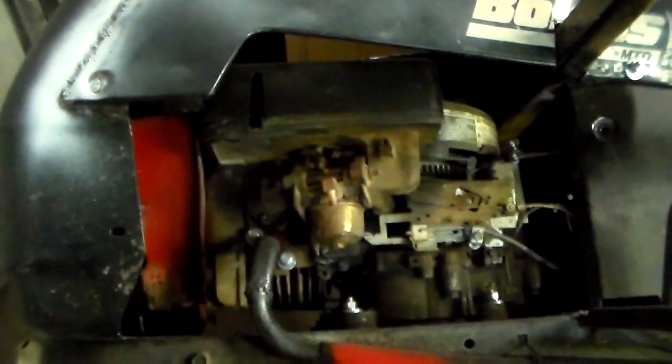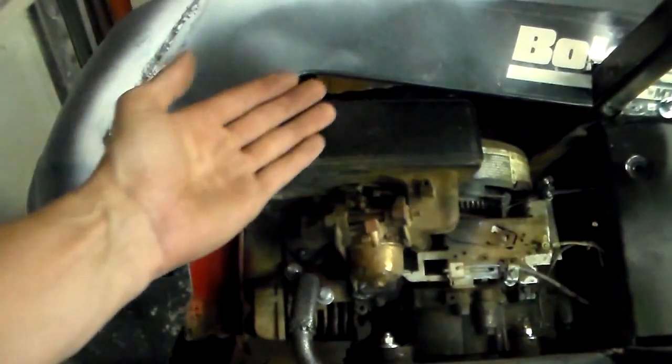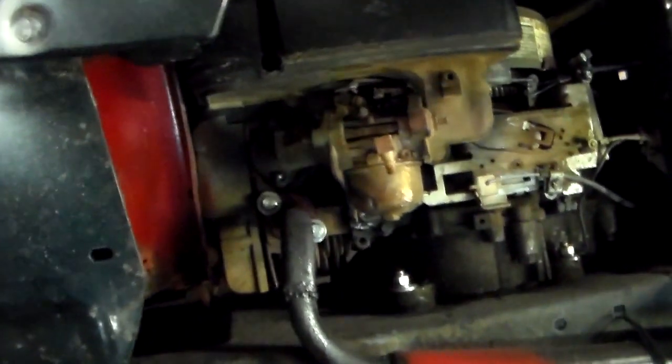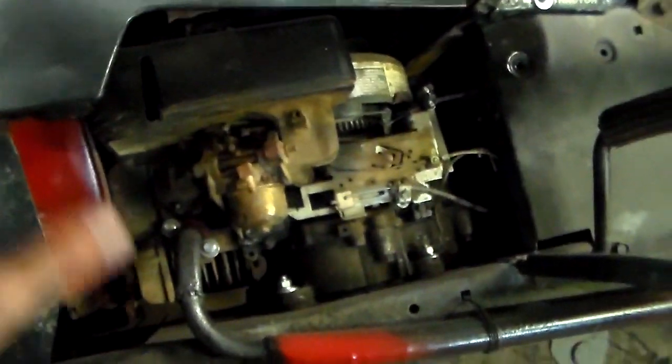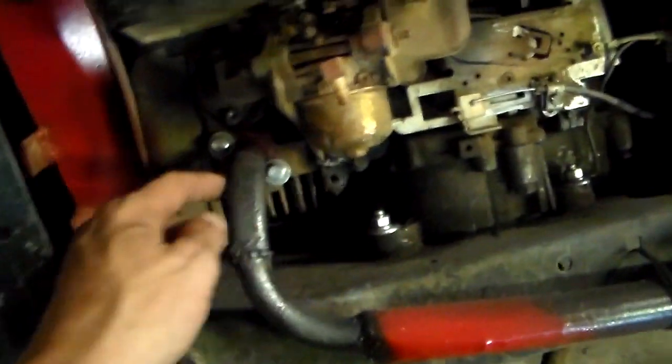Here's how I like to run them. I used to run stacks until they started tearing my engines up, because they would literally get ripped off the hood and the bent side and just tear the block all up. So now I start running these downpipes. They sound just fine. They don't get hit. And they work. They actually make the motor perform the way it's supposed to.